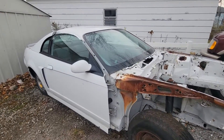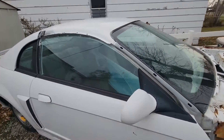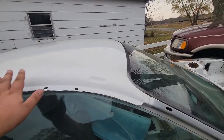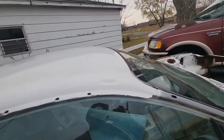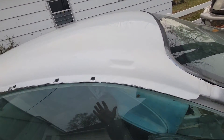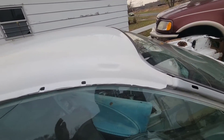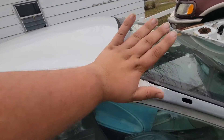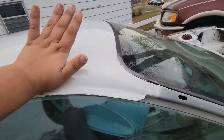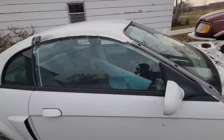I figured I'd go over a little bit of what we've done. In the last video, we were talking about all of this here. This is not the same coat - I'd sanded it down. It looked decent, but I didn't realize there was a lot of fish eyes and there was a ton of orange peel, and so it allowed rust to come up through the material. I did it again and it went through and it's really nice now. So that has changed.